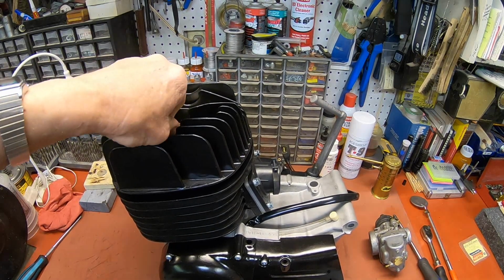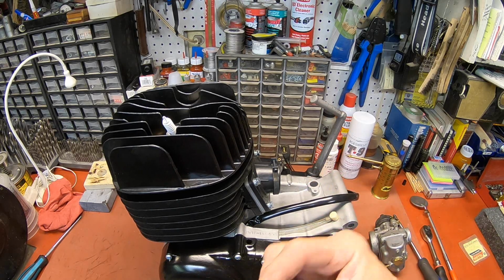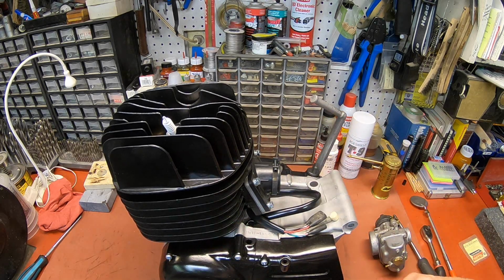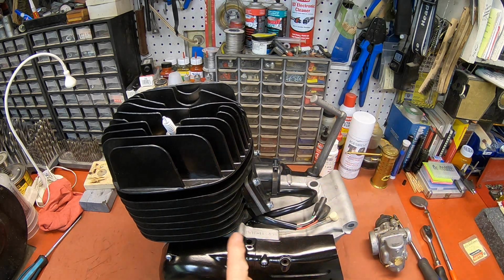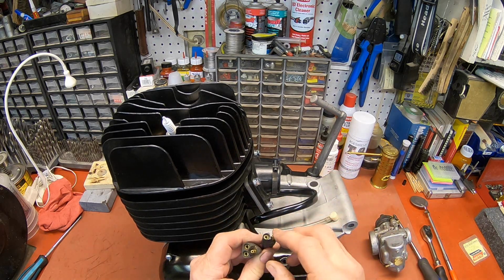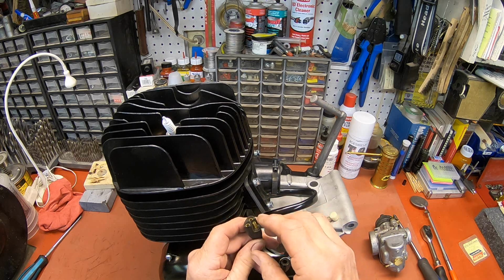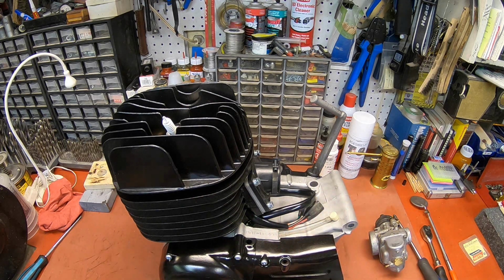And I just had this cable and clamp, and I don't need it with this one, the way it goes in there, so I think we're good to go. I don't think we'll have a problem with the cable. But I just had to enlarge that just a little bit just to get the 3-pronger in, because on the 72 I think you have a 2-prong, and then the rest of them are single bullet connectors, I think. Can't remember. But that's how this one is, so I had to enlarge that hole just a little bit.